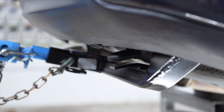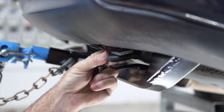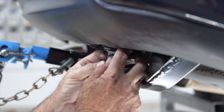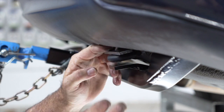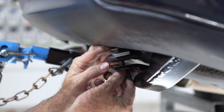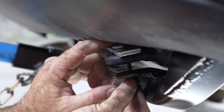With that bolt in, we'll go ahead and put our flange nut on so we don't lose it. Now we're going to take the other flange nut and loosely install it on the bolt. Now we're ready for the tow hook attachment. We're going to take the provided carriage plate, put it on top of the tow loop, take the provided carriage bolt and go through the plate and through the tow loop and then into the hitch hole, then loosely install our conical washer and nut.